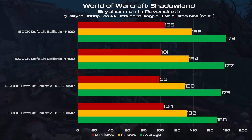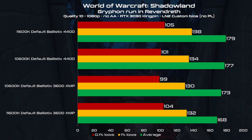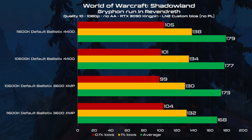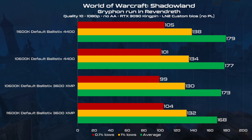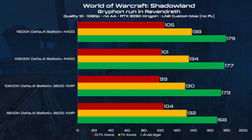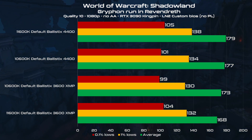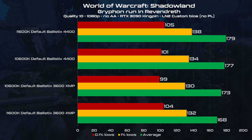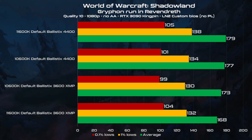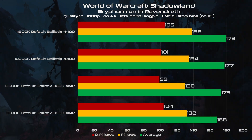Let's start with the simple chart. At the bottom, you can see the 10600K versus the 11600K with the Ballistix kit set to XMP. It's not impressive at all — 5 FPS less than what should be a newer product is kind of weird. But with the memory overclocked to 4400MHz and an easy sub-timing setup, the 11th gen showed a small advantage. And that made me think there's more in the picture to discover.